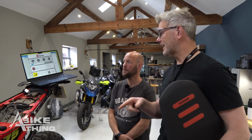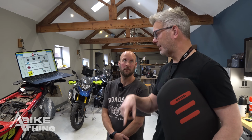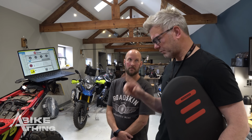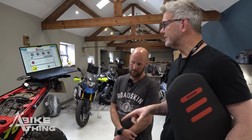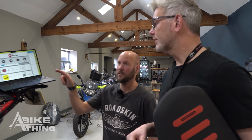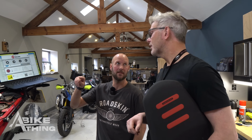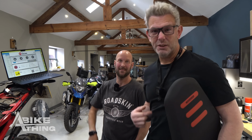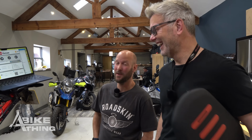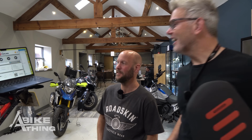So we're at ABR soon, and it's going to be sat on the staging area with the ignition on. What's going to stop that from dripping on the floor every 90 seconds? Because it's going through the ezCAN, there's a parameter on there that it won't drip any oil unless it's doing 10 miles an hour. Very clever. So yeah, you won't have a puddle under your bike if you leave the ignition on.